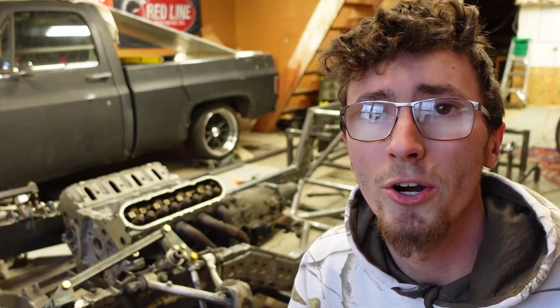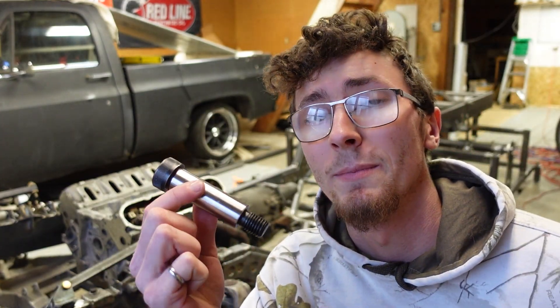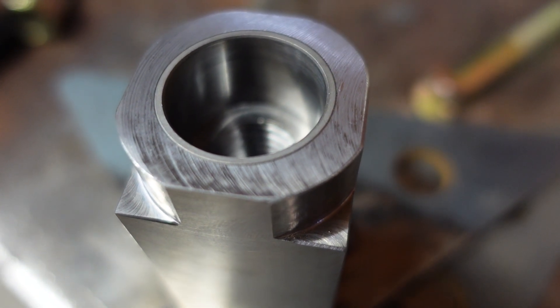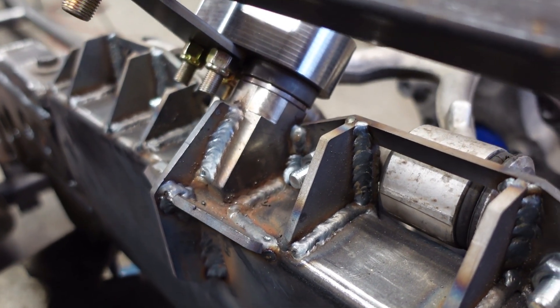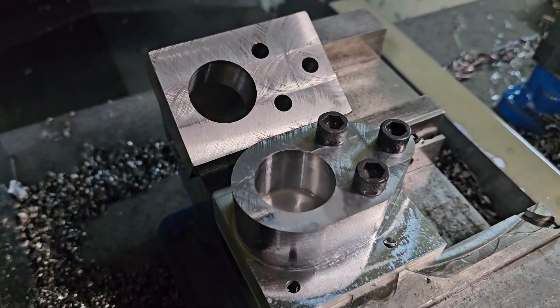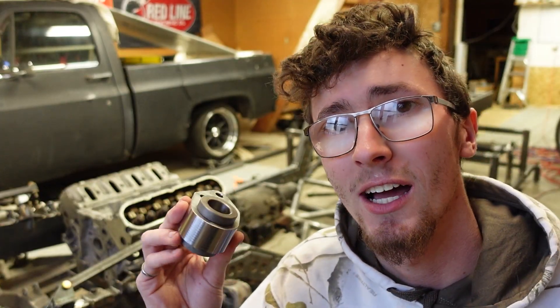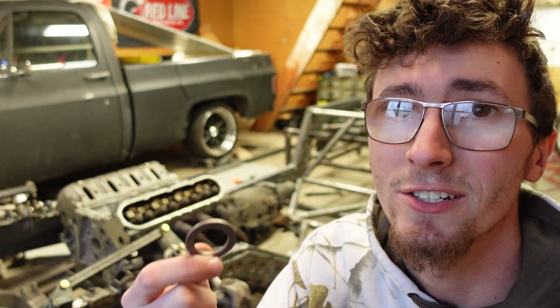From everything that I have seen, this design is pretty unique, mainly due to the large shoulder bolt that I am using instead of a bolt with a bushing that is being supported on the end. The magic with this bolt not needing to be supported on the other end is all in the mounting blocks on the chassis — there is a counter bore with a drill bushing for a high-tolerance surface for the shoulder bolt, letting me bury it down in there and give it as much strength as possible. The main section of the bell crank I machined from 4140, and there is a drill bushing pressed in on each side. These drill bushings are incredibly strong, bored to a tight tolerance, and fairly resistant to wear. To help even more with wear resistance, I have a bunch of high-load bronze washers — bronze is a great bearing material because it has a high lubricity factor and it's pretty wear resistant — with one of these washers on each side of the bell crank bushing.